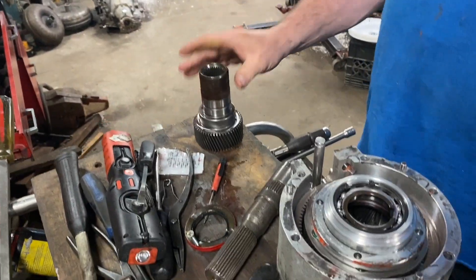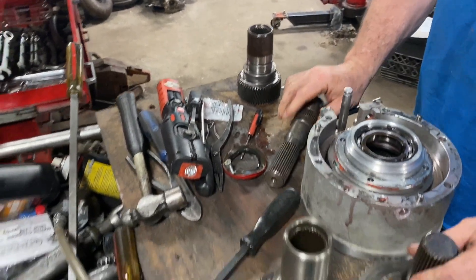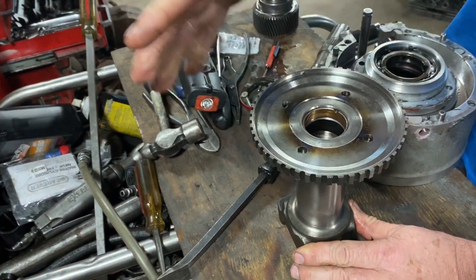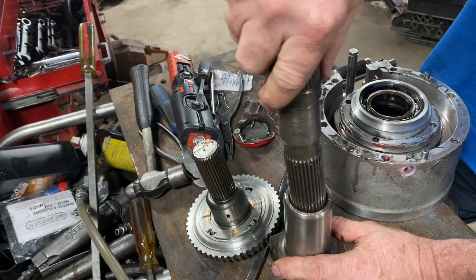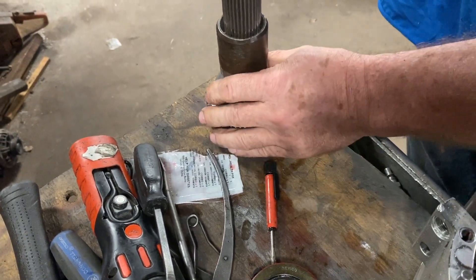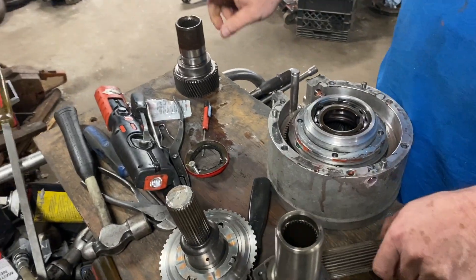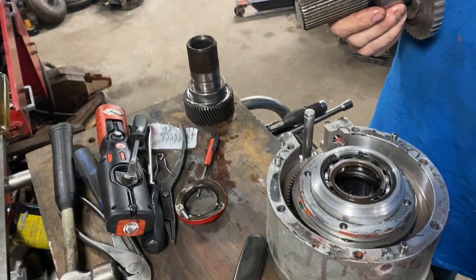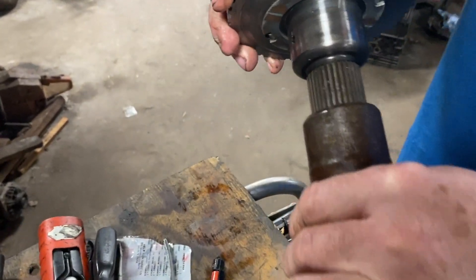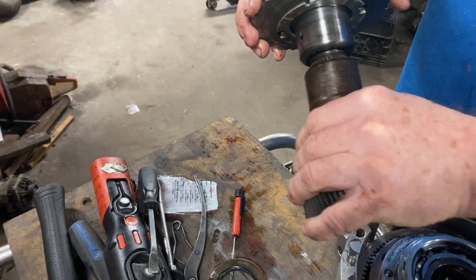This is the spline out of the transfer case and this is the spline we were using. The GM spline fits in — you can see that with a GM yoke it goes right in. But the Ford will not go in because it's not worn out. These splines are worn out, which allows the 31-spline Ford to appear to fit — but it won't go into one that's not worn out. We can see and hear the play in this one because the spline teeth are worn on the inside female end — I can wiggle it back and forward. On the other one, you cannot.